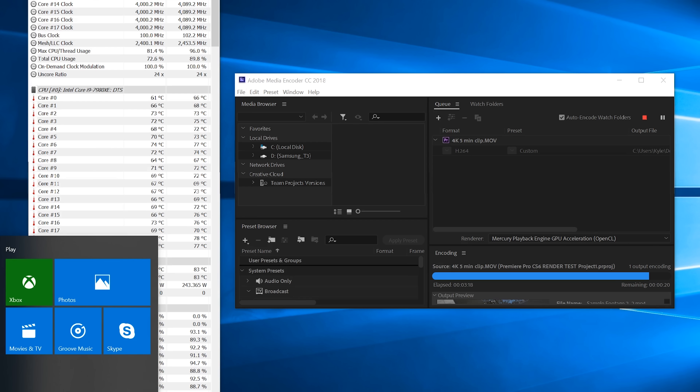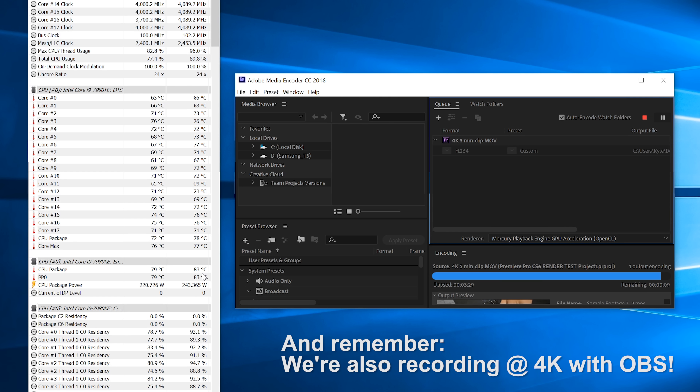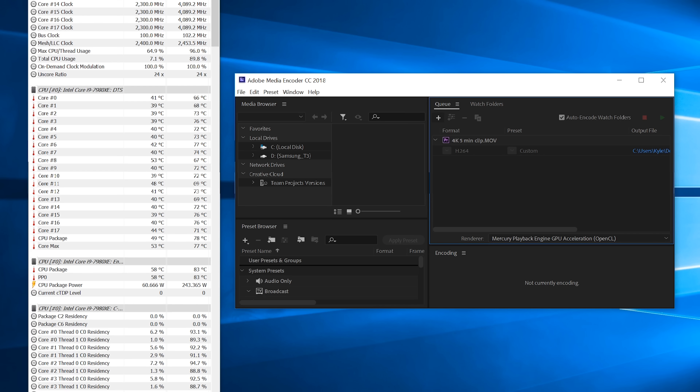I should probably let it finish rendering just to make sure there are no last-minute issues. We only got about 10 seconds left of our render. 83 degrees C is looking like the hottest the CPU got — that's down from 104. So yeah, it definitely worked. We were able to render this in about four minutes, as opposed to nearly triple that when it was overheating. That's how thermal throttling works — now the CPU stays within its thermal constraints and doesn't have to downclock to stay within operating boundaries. My first D-Lid was a success, and liquid metal isn't quite as intimidating as some may think. Thank you guys for watching — if you enjoyed it, toss a like on it, get subscribed for more, and I'll see you in the next video.